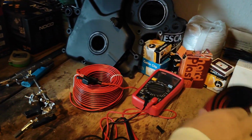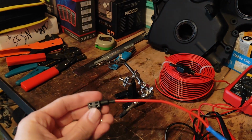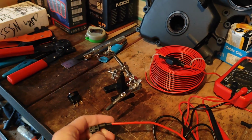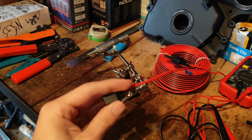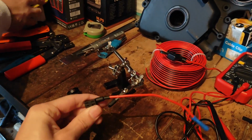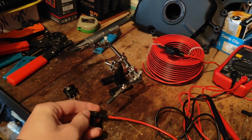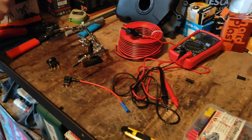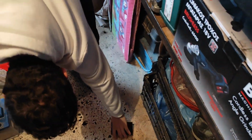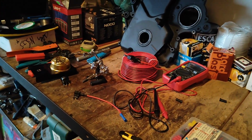So by checking with the multimeter, we come to an understanding that the idea with the valve exhaust system will not work, so we'll eventually just cut this off pretty short so it won't be wiggling around the fuse box. But yeah, we'll have to get another of these to do the same thing, or not actually the same thing, put it on a fuse that gets power only when the key is on. Yeah, you did not see that, but other than that, let's get started.